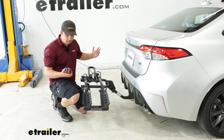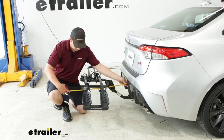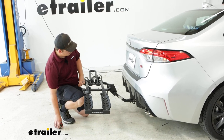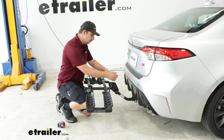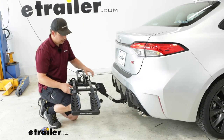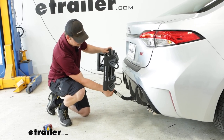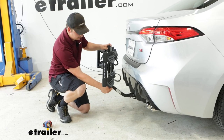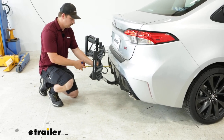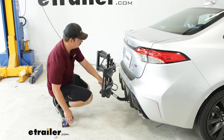The distance added to the back from the bumper to the furthest out point is only 25 inches, so it doesn't add too much length to the vehicle, making it still easy to drive around with. If you want to leave it in the hitch between rides, you can pull out the threaded pin near the hitch and fold the rack up, then re-thread it with the newly aligned holes. The threaded bolt helps keep that pivot point solid, condensing things down to only 12 and a half inches sticking out, which is great.